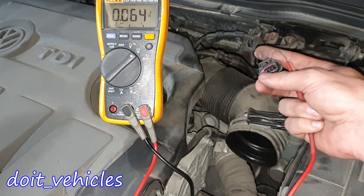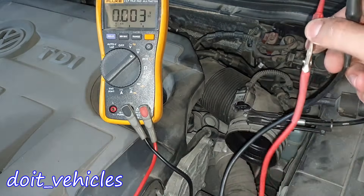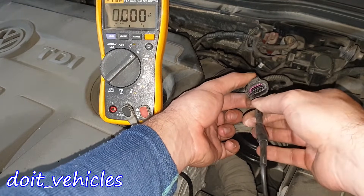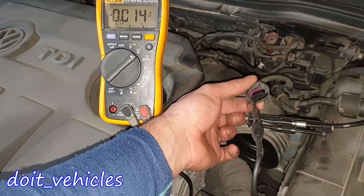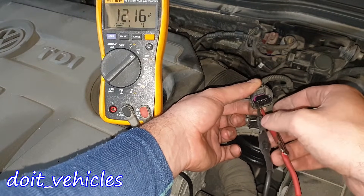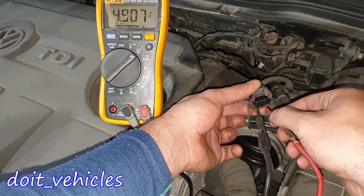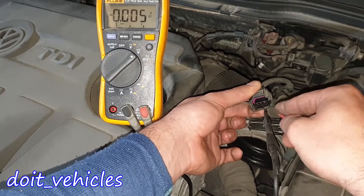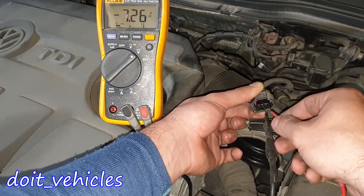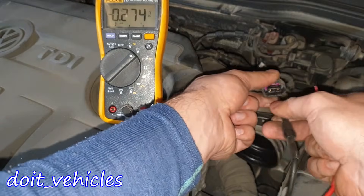The signal wire comes back through the signal pin — this pin on the left is going to be the signal wire. Now I'm going to disconnect the terminal from the ground and check voltage differently by connecting the negative terminal on pin 1. Between pin 1 and 2 we get 12 volts. Between pin 1 and 3, almost 5 volts. Between pin 2 and 3, we get 7.2 volts — that's the difference between the reference wire and the power wire delivering 12 volts. These are the values you need to read at the connector.